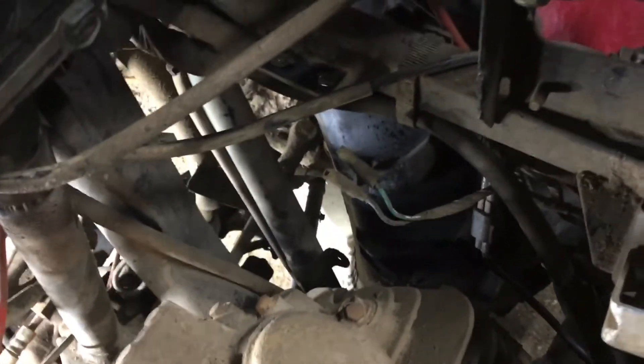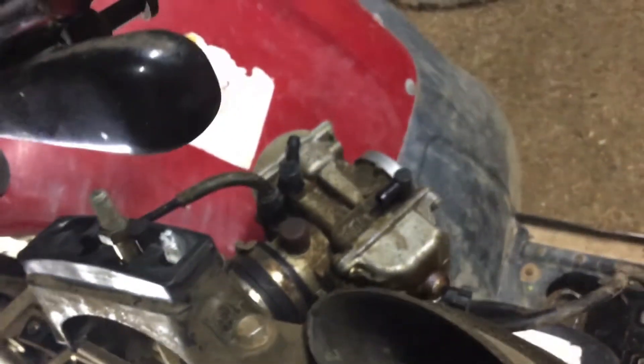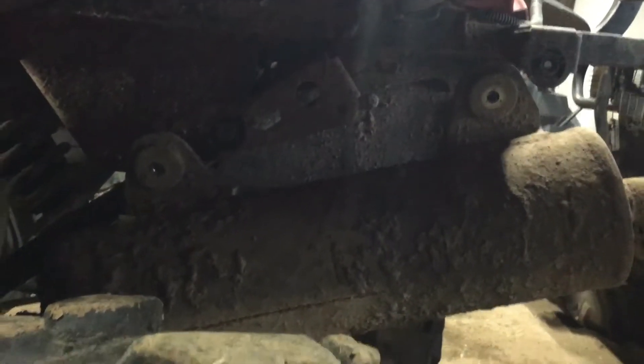I got the carburetor off there. Got that motor mount bracket out of the way. The coil also attaches to that motor mount bracket, so you'll have to undo the coil from the spark plug and undo those two wires from the coil, and then that whole bracket will come out of the way. Got the carburetor off, set it over to the side. Got the exhaust off of there — undone the two exhaust bolts on the cylinder head and the two exhaust bolts underneath there that hold that muffler to the frame, and it just slid right off.